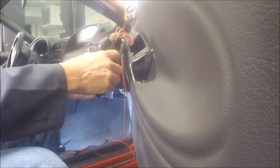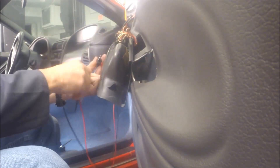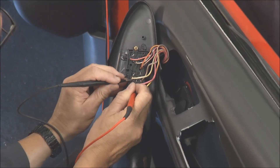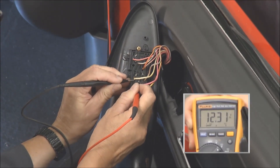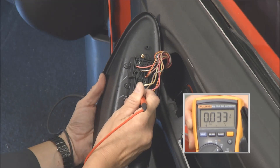The first thing we want to do is check power. I'm going to find the power to that pink wire — we want to make sure we have power there. I already verified the customer's concern. Going to the pink wire, I can complete ground right there, and I do. We've got 12.31 volts on that meter. What does that tell us? It tells us we actually have voltage coming to this switch.